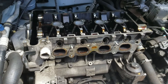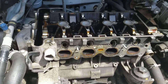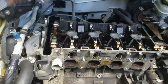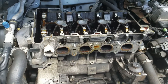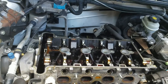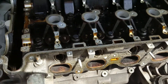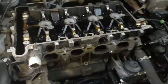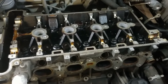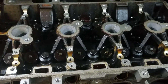As you can see, I already removed all the camshaft and rocker arms. You don't have to do this — you can just rotate the engine to the right in firing order and perform it. But since I'm removing the head, I got to this point and I'm going to show you how to perform it. By having the camshaft and rocker arms removed, all the valves are sealed — meaning they should be closed. So there's no doubt that if I have a leaking valve, it's not due to a lifter putting pressure on it, or lobe, or out of timing. It's strictly due to a bent valve.